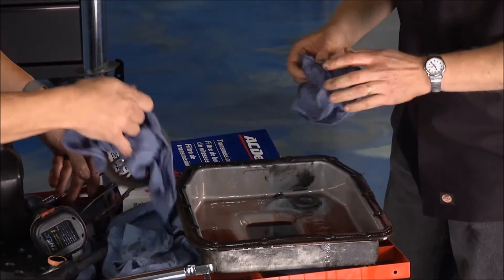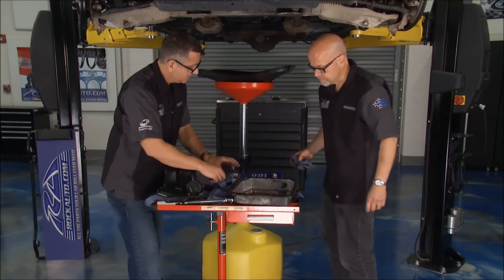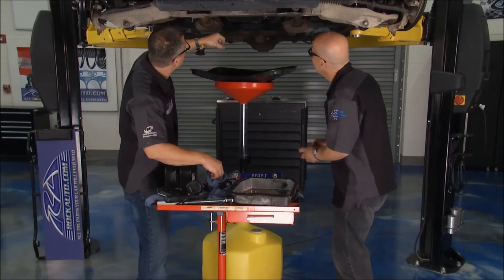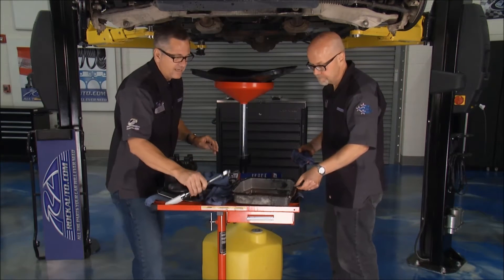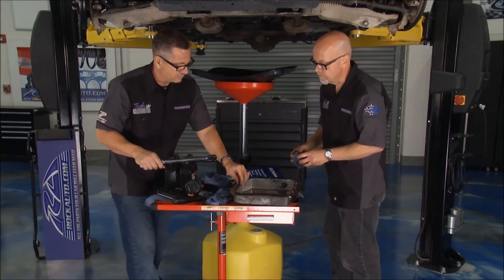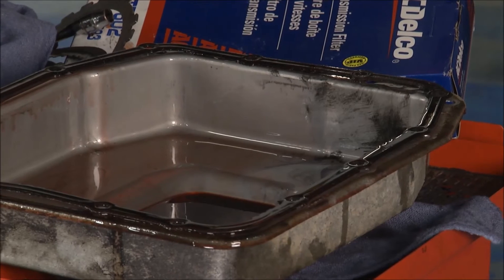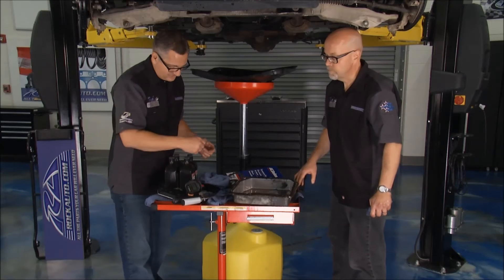There are additives and fluids to put in there. Now what we need to do is clean this pan really, really good. You can wipe down the transmission surface and all the surface around here and some of the valve body — get it cleaned up. Now, just as important: you want to use your torque wrench and the torque specifications. This one calls for 10 foot-pounds of torque for putting these bolts back, because we got our gasket made out of a material — we don't want to crush that and have any leaks. Then we're going to go up top, fill it, warm it up, and follow the manufacturer's specifications for checking the transmission fluid. Always like to take it on a test drive, come back, and recheck it.